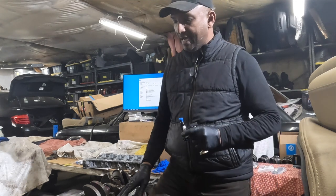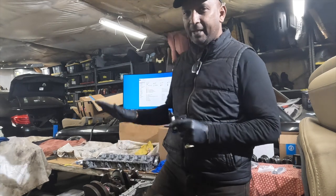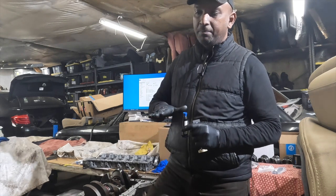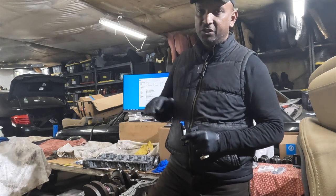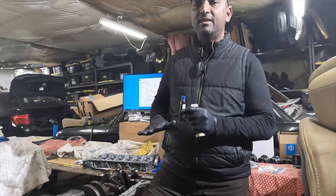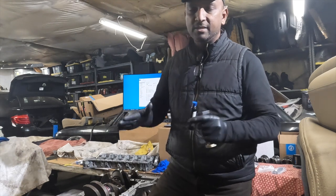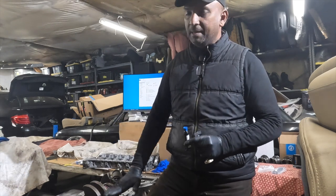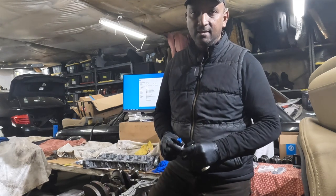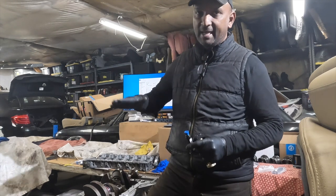it's my belief that applying an RTV or any type of a sealant on the surface and then putting the bed plate on, you run the risk of putting a gap between your plate and your block. If you have a liquid, it's going to compress and come out, but you're still going to have some type of a liquid in between there. You guys remember from science class, liquid is an incompressible fluid. So it's going to raise that bed plate up.